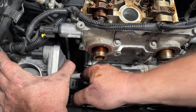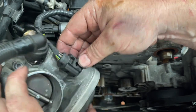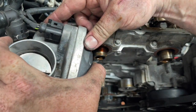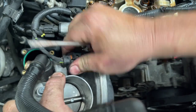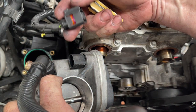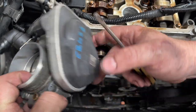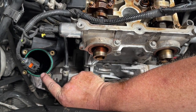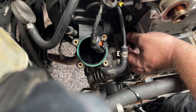With all four bolts out, you can pull the throttle body out of the way. That makes it easier to get to this connector here — there's usually a little tab you can press and slide it out, but this one looks like it's been damaged. It does have a broken clip, so that's something to think about when we put it back together. It looks like it may have been replaced at some point. There's also a rubber seal that sits around here — that's typically in good condition and you can reuse it, but if it's perished, obviously replace it.